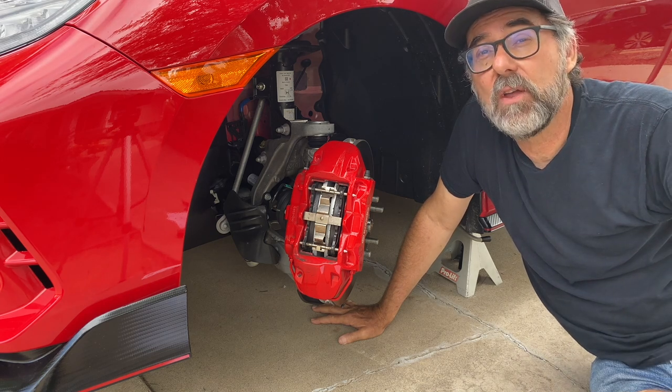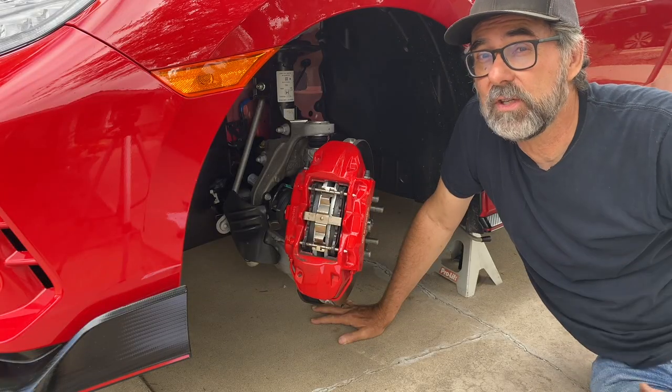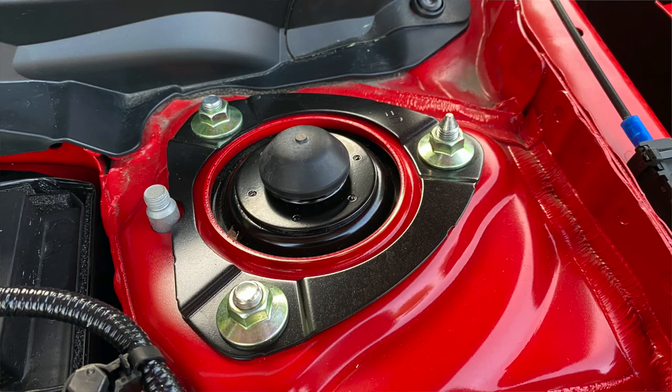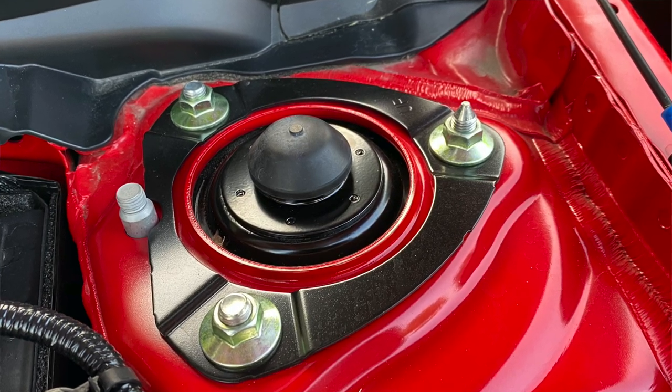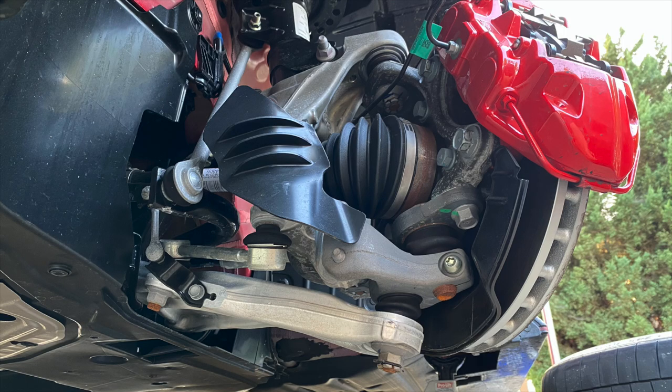Well, the Type R has 306 horsepower coming out of its two-liter turbo engine, and it's all coming through the front wheel, so they had to do something to combat torque steer. This lower ball joint at the end of the lower control arm looks fairly conventional and it indeed works with the pivot bearing at the top of the strut to define the axis of the suspension's vertical movement over bumps. But the dual axis design means these two familiar suspension hard points don't have any real effect on steering geometry. That's where the added upper and nearly hidden lower ball joints come in. Their independent orientation allowed the engineers to redefine and optimize the steering axis to best suit the Type R's performance mission — putting down all that horsepower and giving it really good steering feeling so that it's fun to drive.